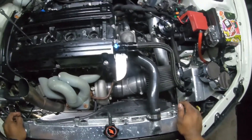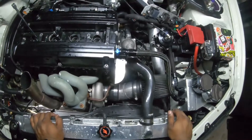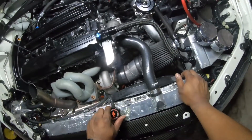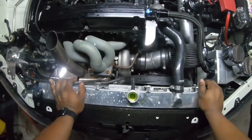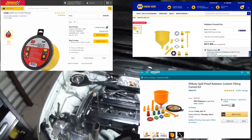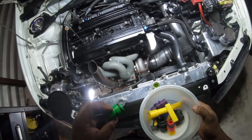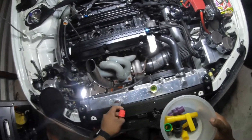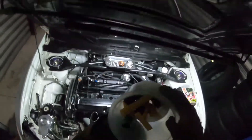I want to take off this coolant cap and use a little trick to make it easier to see bubbles and check for compression leaks. The Mishimoto cap comes off — it blew out a little, but that guy's nice and full, which is a good sign. Now I'm going to set up my coolant system funnel — you can get one at any auto parts store, they run about 30 to 50 dollars. Find the right fitting — color and letter coordinated, B goes with B — and seat it in there.